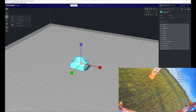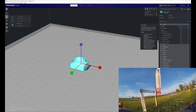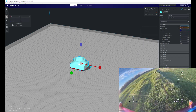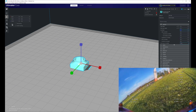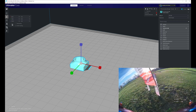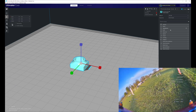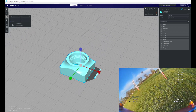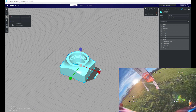Let's take a look at some of the other settings and drop the layer height to 0.2. The precision matters but it doesn't matter as much as you might think for an object like this. We're going to use compression to kind of hold everything in place rather than rely on the exact threading. It's really not as finicky as you might think, but you do have to try a few times — increasing or decreasing the scaling — if it doesn't work.